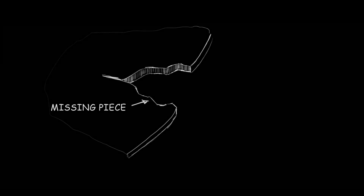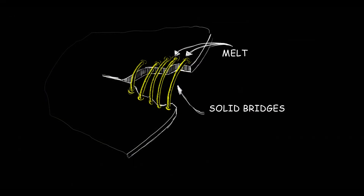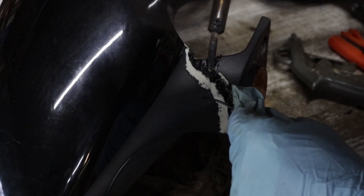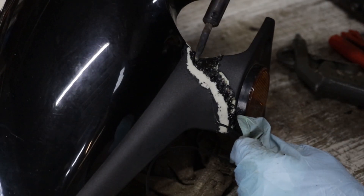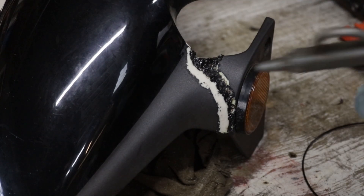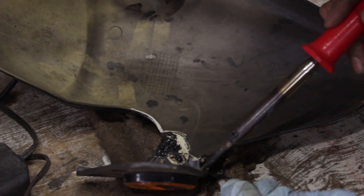Part 3: Making Up Material. The last thing I had to tackle was how to build up material from a missing piece I didn't have. To do this, I melted ABS stitches at both ends and left them unmelted in the middle. Then when they were cool, I would go back and melt ABS over these bridges to fuse everything together. When the bridges started to droop, I'd freeze them in place with a blast of cold air. This turned out to build up material just like new.